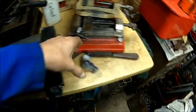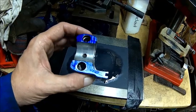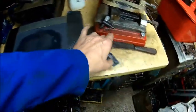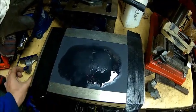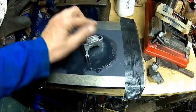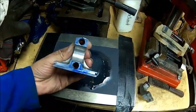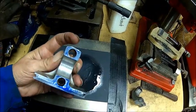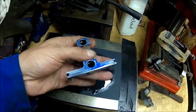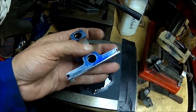We have some more work here. We need to get those flat because it was ridiculously worn. I already did one pass — it's 400 grit sandpaper with oil. This other one basically kinks off this way. Just one stroke and you can see where it's threading. It's a lot here, a lot here, and something here — that's our problem. Then we're going to lap the inside diameter because I already lapped the journals of the camshaft.